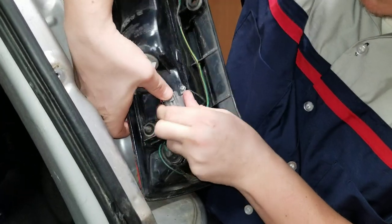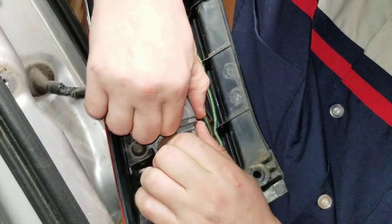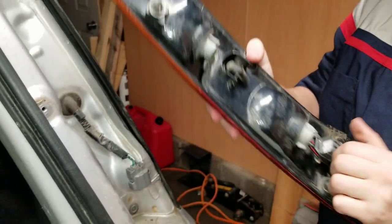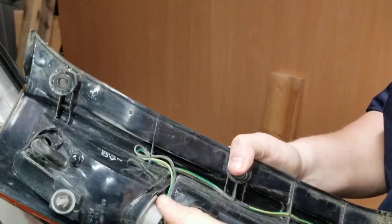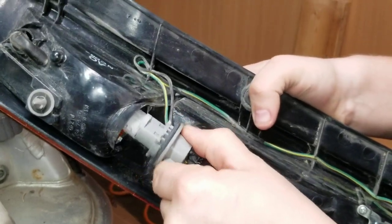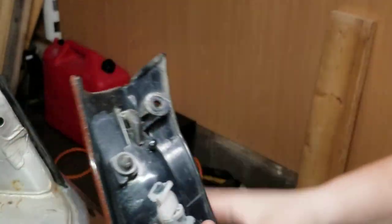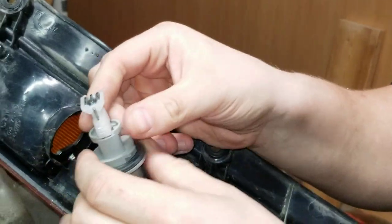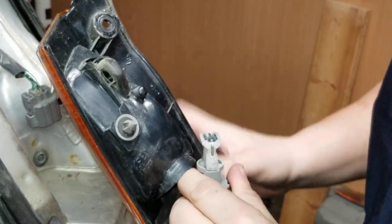But in the long run, if I can do this properly in one shot, you save yourself way more hassle. I knew from up front when I was doing it that it wasn't working because my passenger side blinker was blinking extremely quick. Anytime your blinkers blink at hyper speed it usually means something's off.